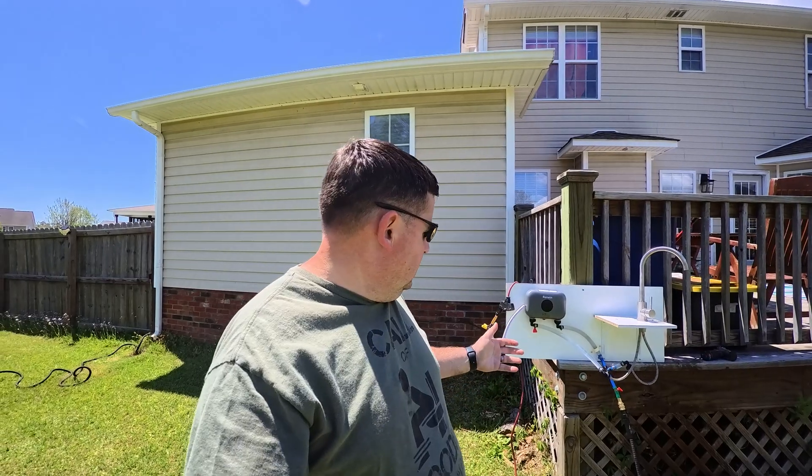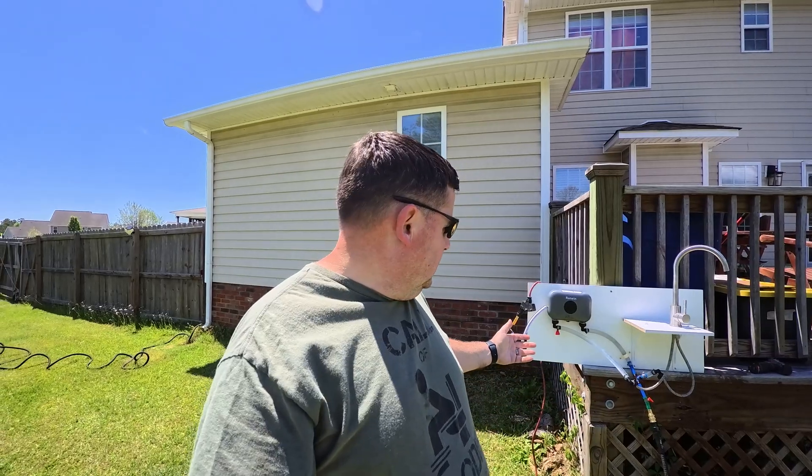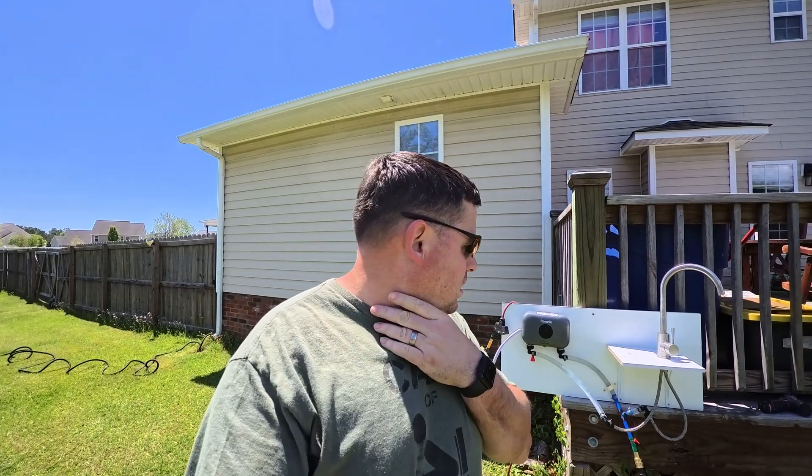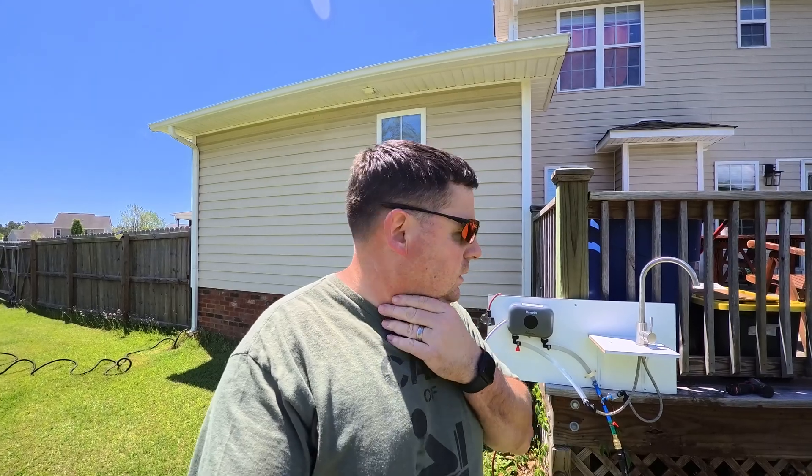It's not necessarily back to the drawing board. The typical RV water heater is on a 20 or 30-amp breaker, but this thing is pulling too many amps — it's just going to pop the breaker. It's crazy that this little thing pulls that much power. A lower-power unit would be great. I was getting hot water — it immediately turned warm and was working — it just draws a lot of power for such a little guy. Let me grab my amp clamp as the last step before I wrap up.